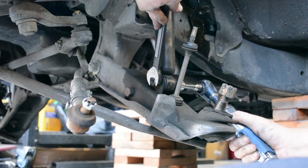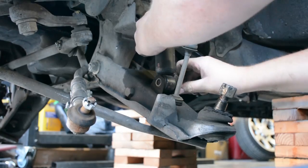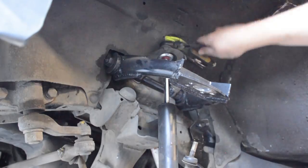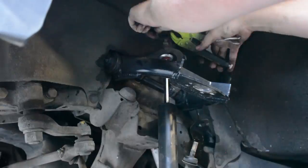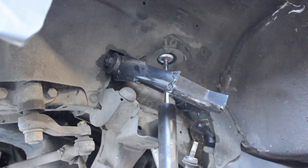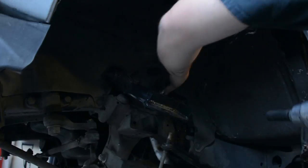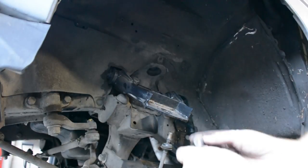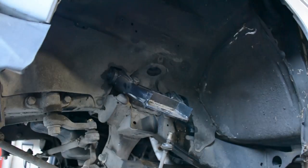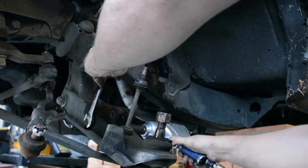Now we're taking apart the shock lower mount and undoing the top. The shock will try to rotate on you, and there's a little tiny notch up at the top of the shock — you can grab that with vice grips, though a proper wrench would probably be better. Now we're taking off the upper control arms. These are my tube uppers that I sell on my website, roadiefabrication.com. They allow more room for bag placement. Always keep note: they have a shim behind the control arm, normally a thicker one and a thinner one, so be sure to remember if it was in the front or the back because that helps with alignment.